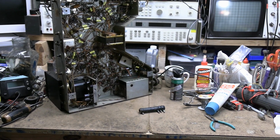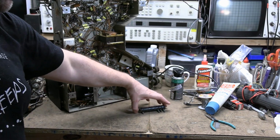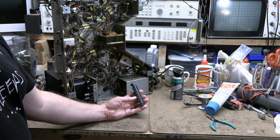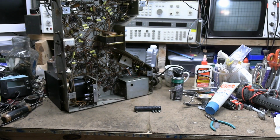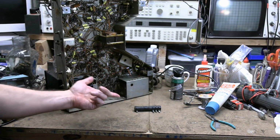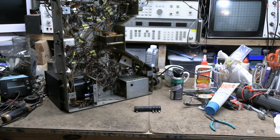Hey guys, if you've been watching my Crosley 307TA restoration project, you may recall that I found this large power resistor inside the high voltage box with every section being open, in addition to some corrosion. In previous projects I've encountered these as well. Certain early RCAs and Admirals have these. It's part of the damper circuits, and they're almost always open.